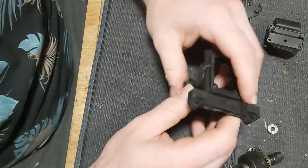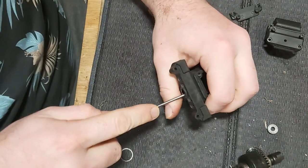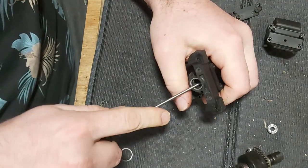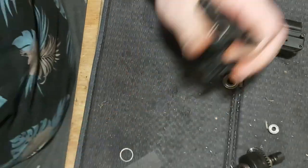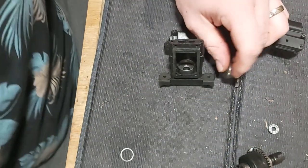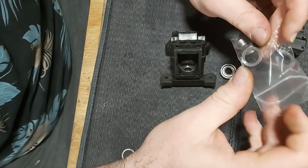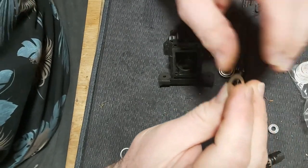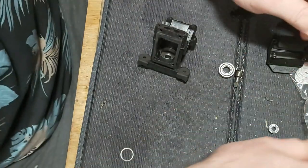So I'll pop the diff out, pop the pinion out, and pop out the bearing from behind. What I've got here is some 13x19 washers — I'll put a link in the description for where to find these. They are 0.2 millimetres thick.